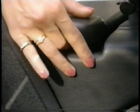Unlock the storage lid. Release the catch lock. Open the storage box lid. A hook type catch prevents the soft top from opening accidentally when the vehicle is being driven. Fully retract the rear canopy frame. Close the lid, finished.